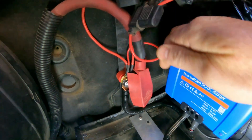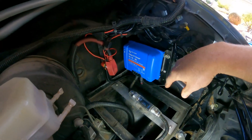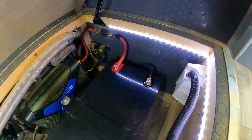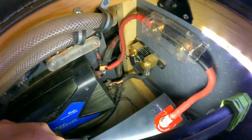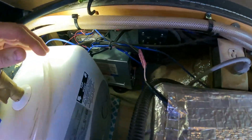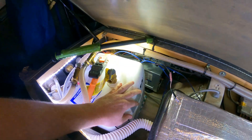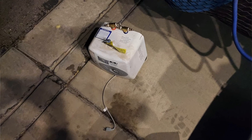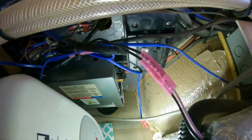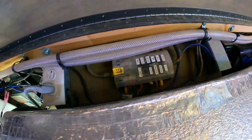These are just basically the wires we use for our auxiliary off-road lights — a nice easy spot to hook up power for those. Back at the electrical box, we got our lithium battery hooked up. Out of the fuse, everything ties into the points on our inverter. Our DC converter charger is back here behind the water heater — I had to pull the water heater out, it was a little bit of a pain, but it fits in there no problem. Off of the DC charger, your positive and negative just tie into our fuse block.